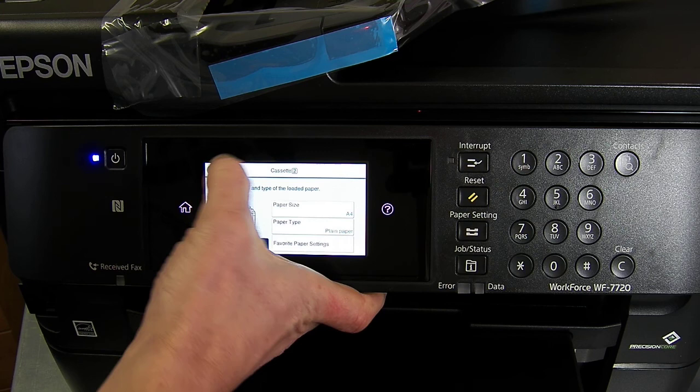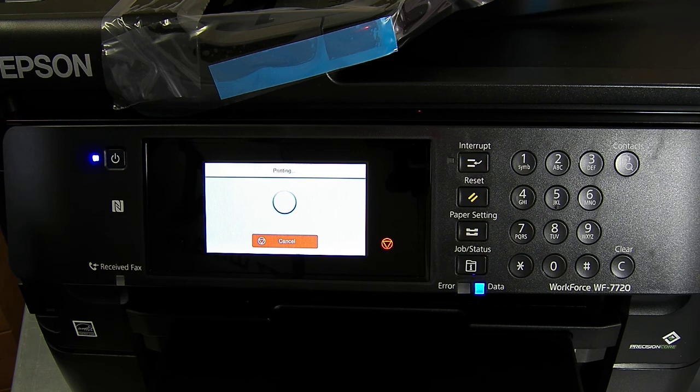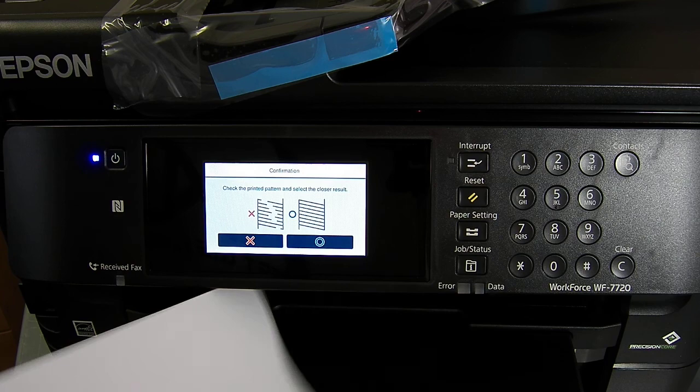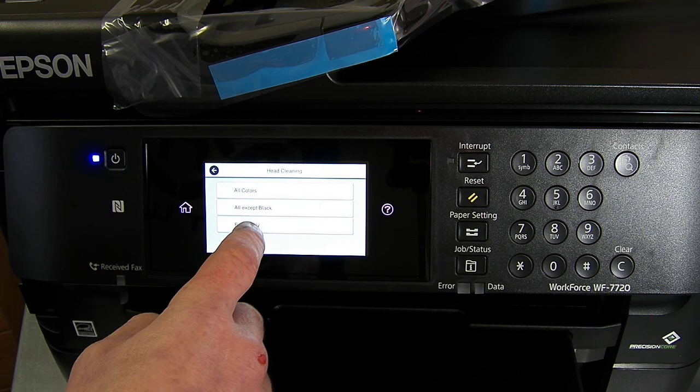Close, paper one, print nozzle check, start. Depending on what the outcome of this is will depend whether or not I have to do any further head cleaning. So we have basically one partially broken nozzle here on the black. So I'm going to do black only. Gonna do one more head clean,